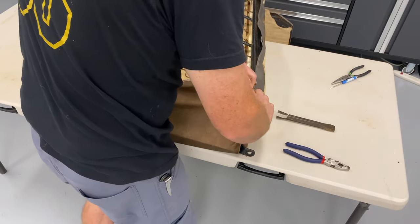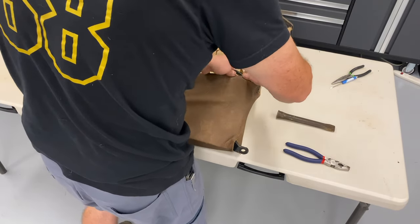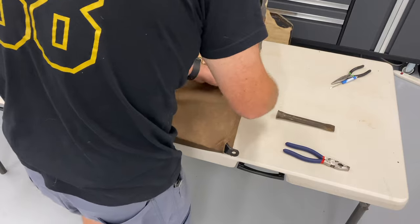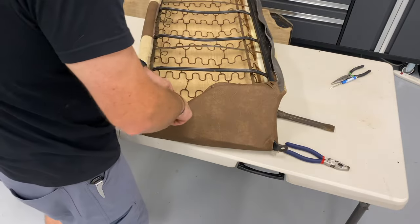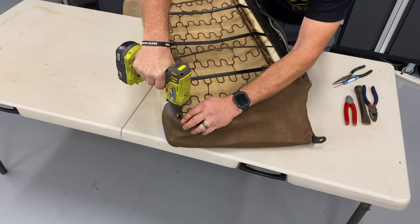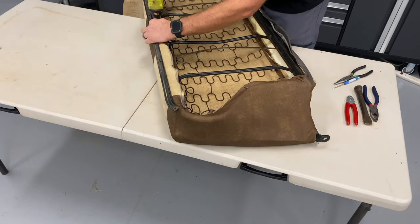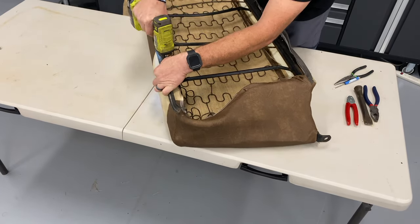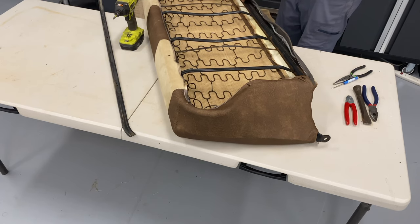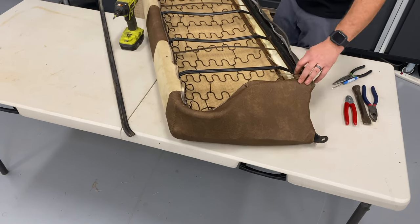This seam we'll tuck that way and roll this over as needed, tucked in behind those spikes. Take a hog ring and hog-ring that down there. Our seat spikes right here and right here — one, two, three, four, five. And then we've got a whole bunch down here: one, two, three, four, five, six, seven, eight for our seat board, which is going on in just a little bit. We've also got a little strap that holds our rear backrest up in place.